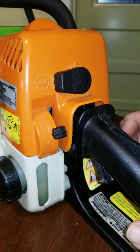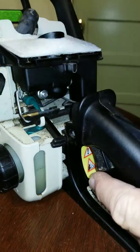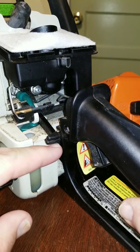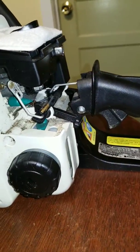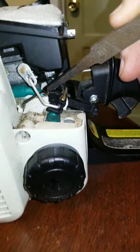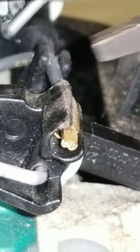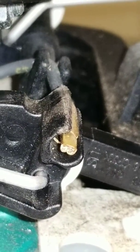You take the cover off and I'll show you the part that got fixed, because this little choke lever in the back can pop out of place in this joint. I'm going to zoom in — right there. You take the rounded edge off that plastic retainer.